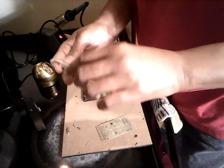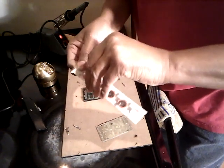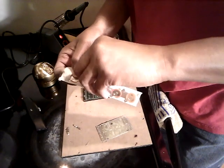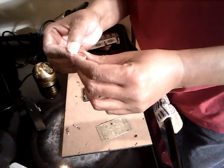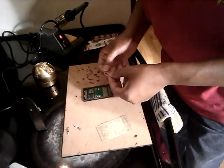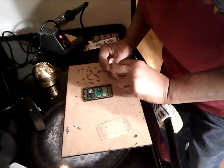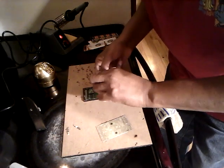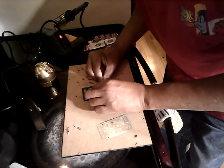Now I'm going to see if I could just easily get one of these batteries in here. You got to make sure it's the CR-2016s because they got to be really thin. If you can see in there, they got to be really thin to really fit. I should be soldering this up — positive is here and negative is here. I might have to put a little solder. Yeah, it looks like I'm going to need a little solder on these.